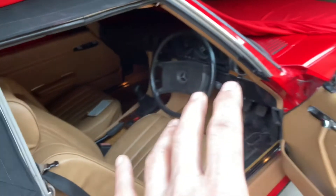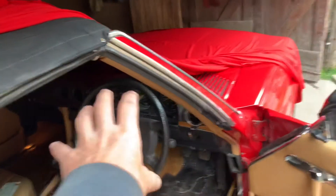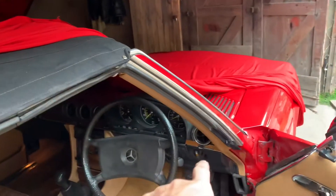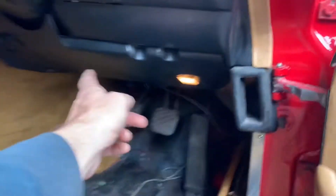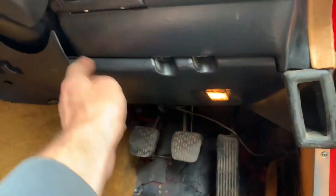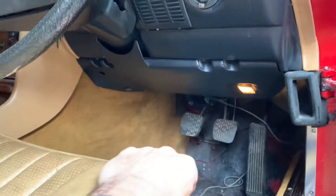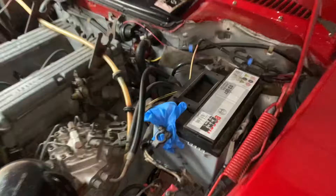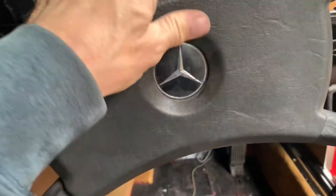So I've got to take the steering wheel off, take the instrument cluster out, and take that bottom panel off. It's usually about this time that most people would start giving up and giving this to an auto electrician - which I totally understand. But having put this car together many months ago, I'm pretty confident everything's going to come apart as expected. First, disconnect the negative terminal of the battery. The centre section of the steering wheel should just pop straight off.